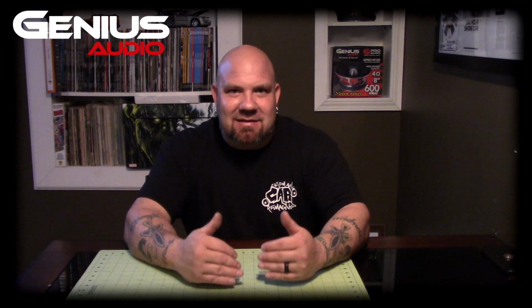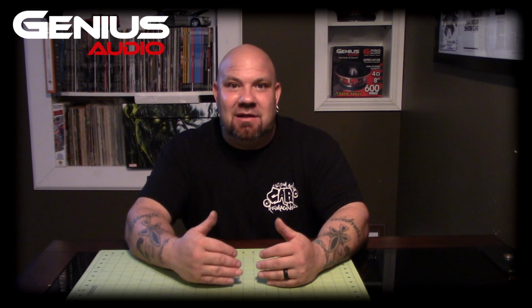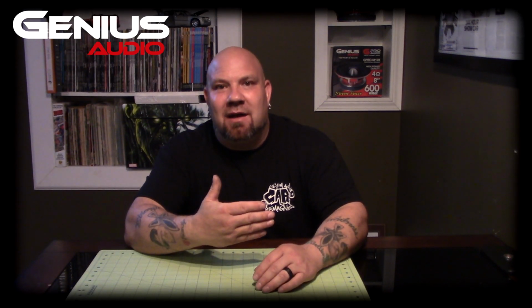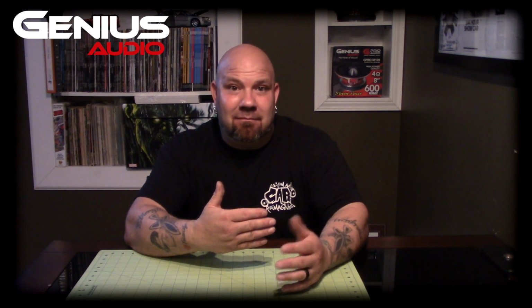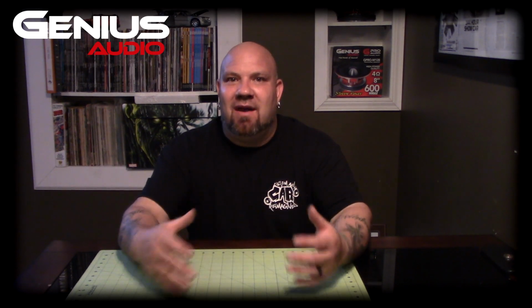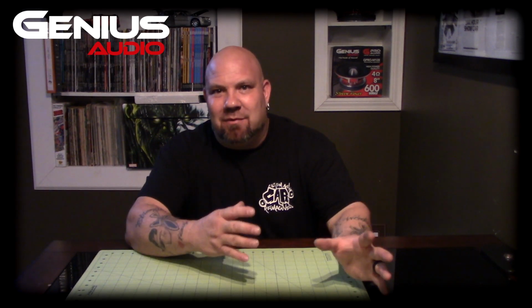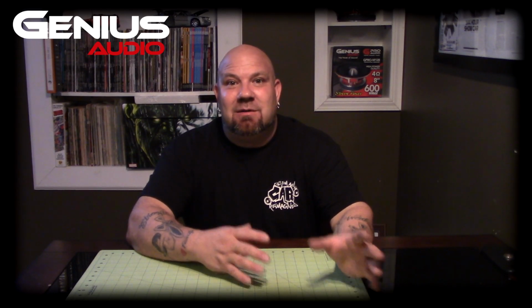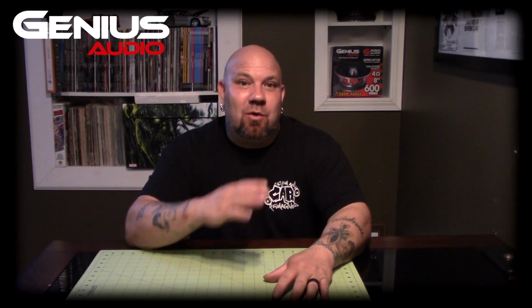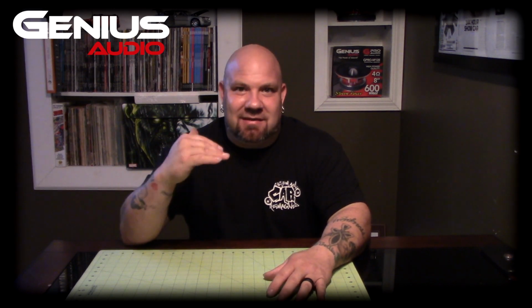The only way I could test an amp that big is if I wanted to invest thousands and thousands of dollars into my test area. And I'm not going to do that because how many of those big amps are going to actually come across my bench? Maybe one a year, if that. So it's not worth it to me to invest how much it would take. To produce the current that amplifier requires, the amperage, to put out the power is insane, especially on a bench. So you saw my voltages were dropping down to like 11 and 10. I mean, it just can't sustain.